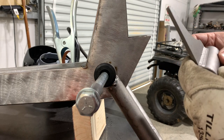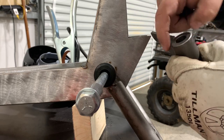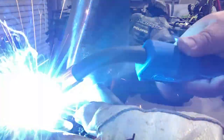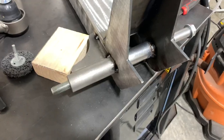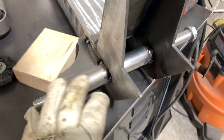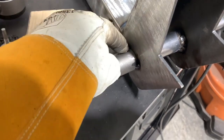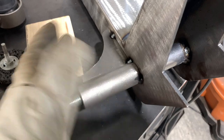It does look like there is some kind of paint coating on this, so I'm going to have to grind off the edge right here where it's going to mount to the crossmember so I can get a good weld. I'm just going to put this bolt in place to hold our gusset, and go ahead and get that tacked up. I've got the gusset tacked in place in three spots on this side. What I'm going to do now is flip the crossmember over and start tacking the back, because if you start welding on one side, the heat will actually pull the metal up and in — it'll start warping everything. So you got to kind of do one side, then move over here, and keep moving the heat around. You give it back and forth — this side, now this side — back and forth until we get it welded in place.